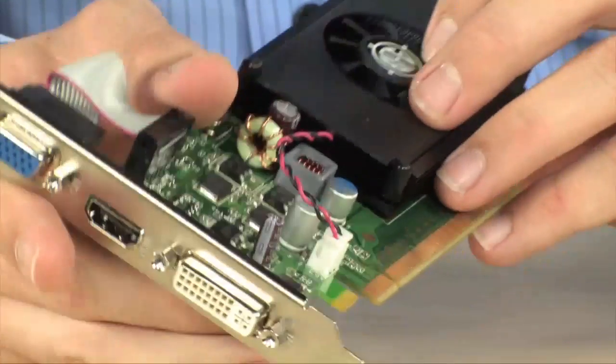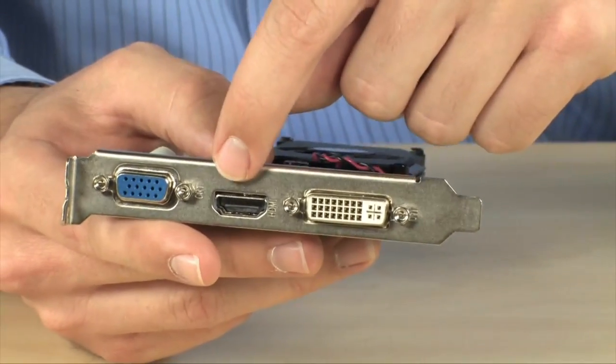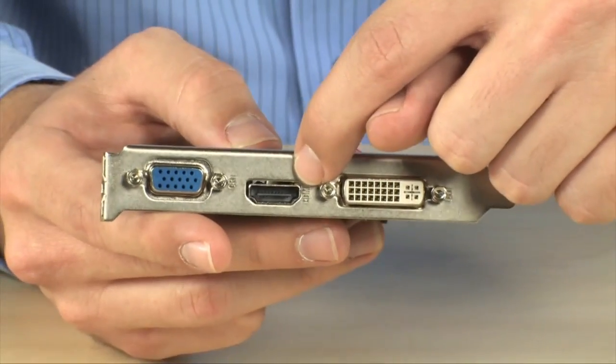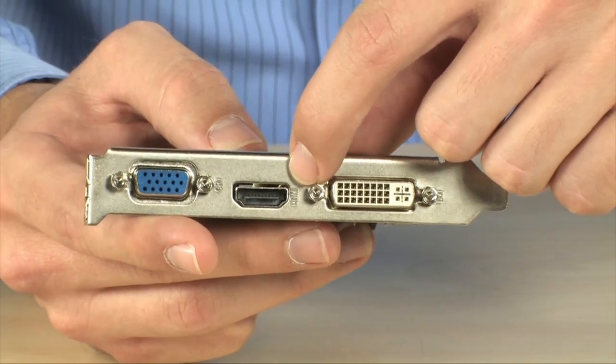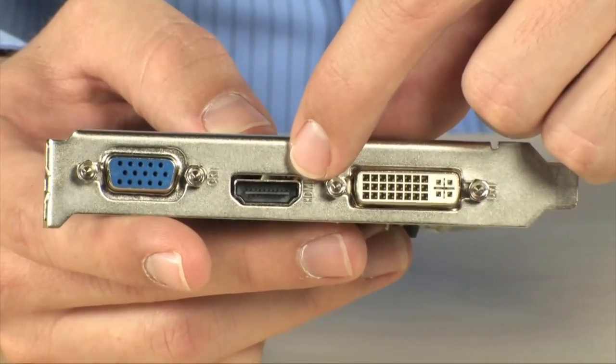This is really good for a home theater PC. It's great if you want HD audio and HD video through the HDMI out to your TV or monitor — it outputs sound through HDMI as well as 1080p video. That's HDMI spec 1.3a, which is important to know and one of the features people are looking for on this type of graphics card.